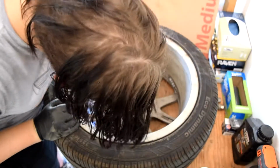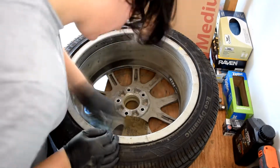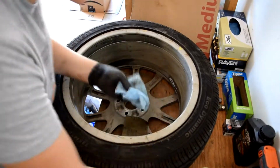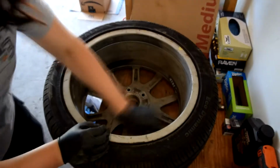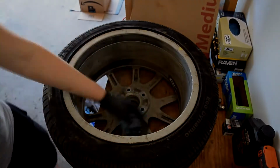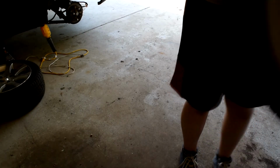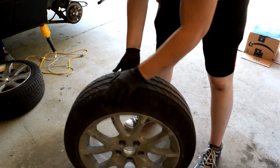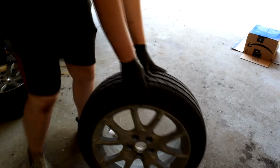Another thing is when you are taking the tire off of the workbench, don't drop it onto the ground and bounce it like a basketball. The tire pressure sensor on the inside will break off and will now rattle around inside your tire. Ask me how I know that. So that was another $60 to replace. So don't be too rough. If you have a modern car, the sensor might be inside there and it can break off and rattle around inside.